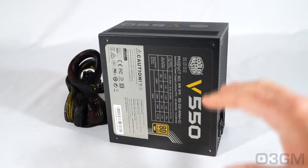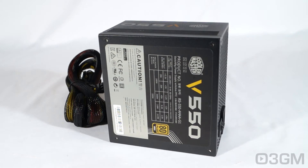I'll be looking at the 550 watt model today and I'll quickly go through how this wattage is determined. To really understand that, you'll need to know what rails are. Rails are basically well-regulated transformers which convert domestic current into the voltages that your computer system can use. There are essentially two different rails: the 3.3/5 volt rail and the 12 volt rail. In this particular case, the approximate maximum peak output of the 3.3/5 volt rail is 100 watts, and it comes with a single +12 volt rail at 540 watts.